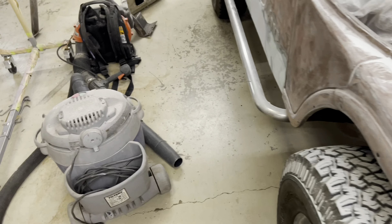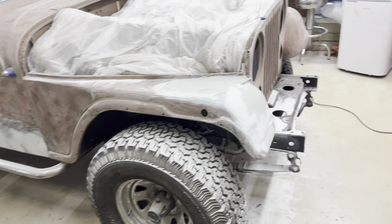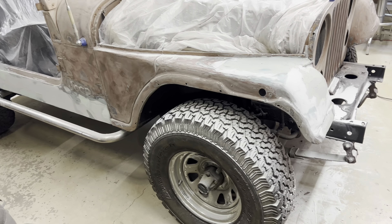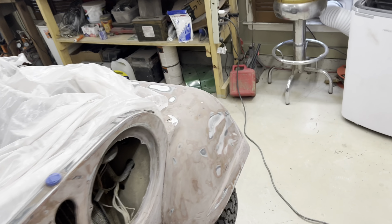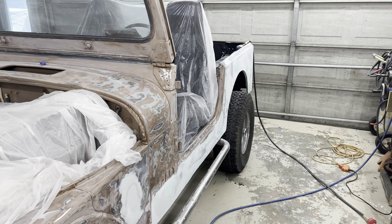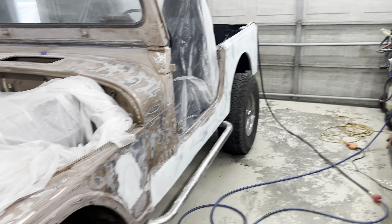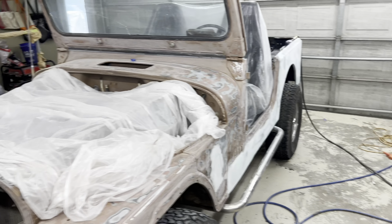Because then at that point I'm going to blow the garage out, I'm going to seal the kitchen door off — the door that goes into the house — with duct tape, and I'm going to 2K prime the entire Jeep body. And if I get that much done today I'll be happy. I think I can do that, and then once it's 2K primed I can look at it and see where the trouble areas are and address them then. All right, here we go.